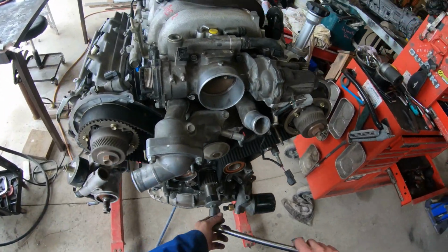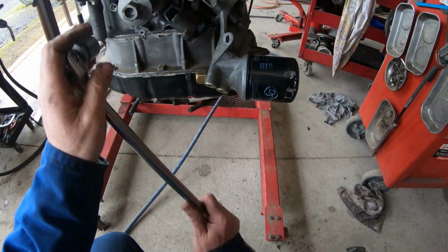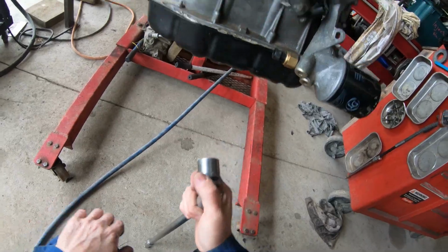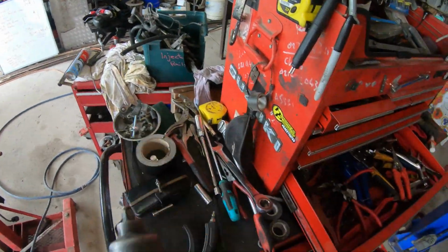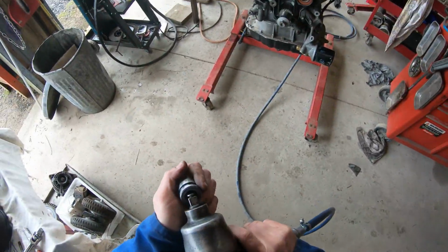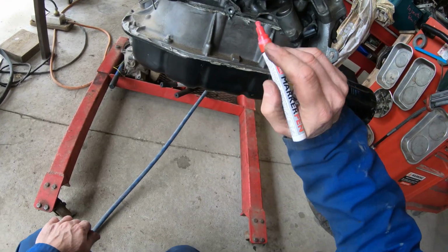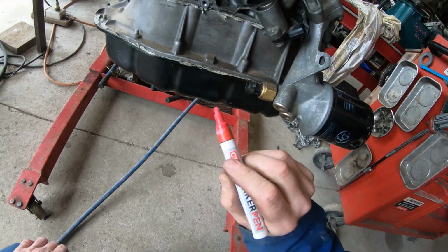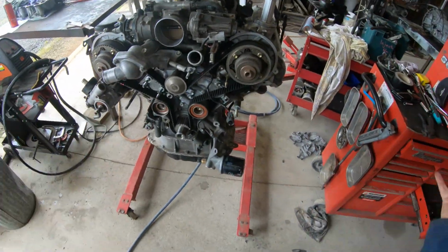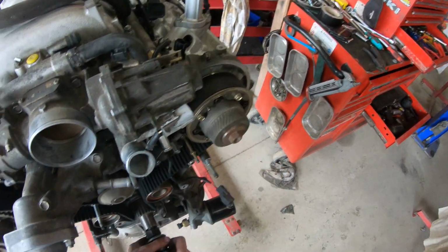Now in theory, if you were using a genuine belt and you actually moved it round to the T, like that, this one doesn't line up. And I'll just do this to prove a point. So if you wanted to line this up with round in here, but it's not really in the right place, it doesn't actually line up nicely. Line that up with the T, line up with the T. It doesn't matter where you actually line it up as long as it goes back on the same point. And you always want it to be back to those proper marks.